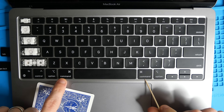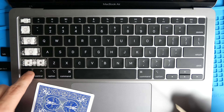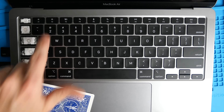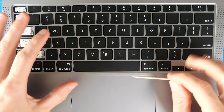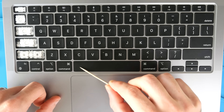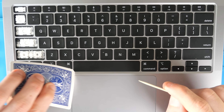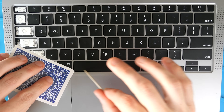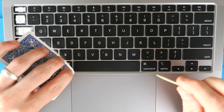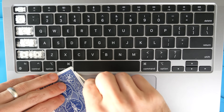The Delete and Return keys are the same as the Tab key; the Shift keys are the same as each other; the Command key is the same as a square key just a little bigger. All square keys are designed the same way, all Fn/Control/Option/Command keys are the same, and all rectangle top-row keys are the same. Now we'll work on the space bar — one of the trickier keys. It has two support bars (one on the bottom, one on the top) and two key switches underneath. Attack from the corner and remove the bottom support bar first: go in from the bottom corner with the playing card and pry it up a little bit.